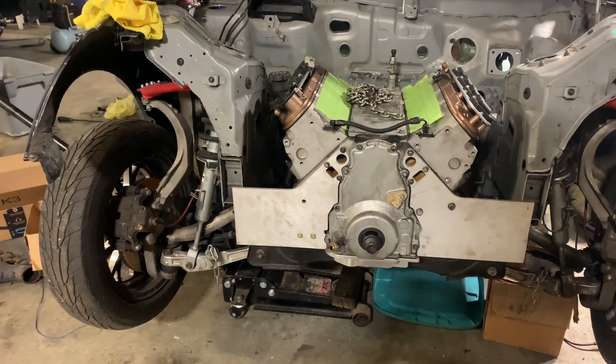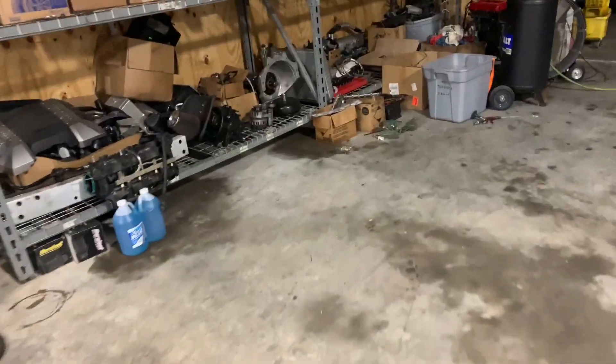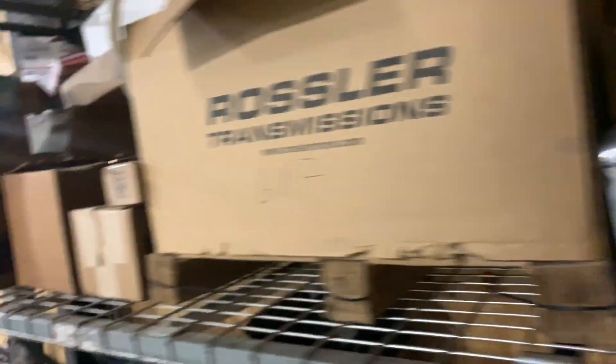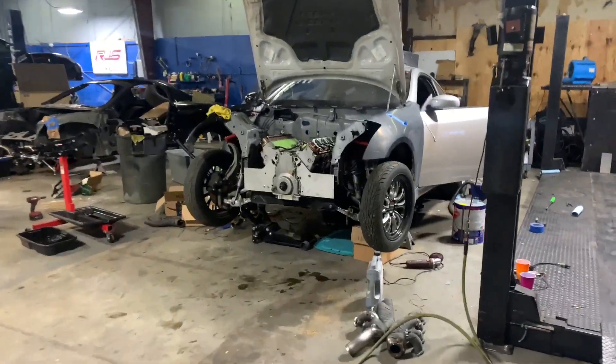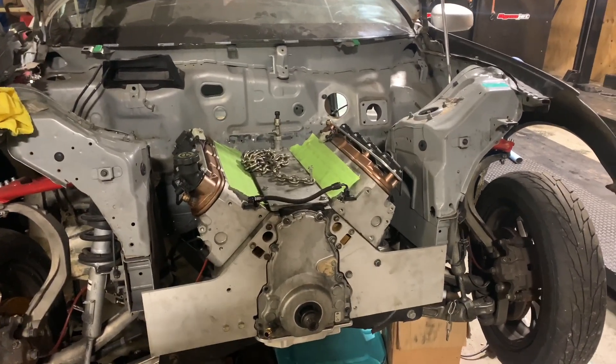I'm going to get the stand made for the turbo. We'll be running a small Honda Civic radiator — exactly that one over there but with a better fan. The car won't be driven on the street much anymore because I'll likely get myself into trouble, and I'm trying to preserve this motor as long as I can — it's the same motor from last season. I want to survive at least halfway through this season, then pick up some connecting rods. I have another 5.3 bare block with a good crank that I'll throw something together on to make about a thousand horsepower reliably, and run that for the rest of the season. I'm going to get an engine diaper for this too. If you guys have any questions or need work done on your car, message me on Instagram or Facebook or leave a comment below. Have a good night.